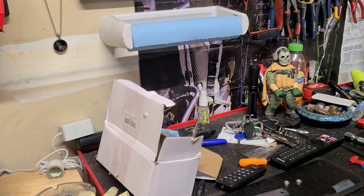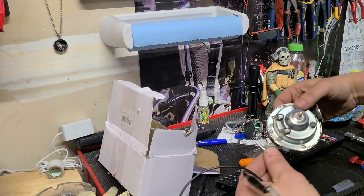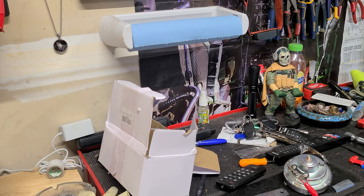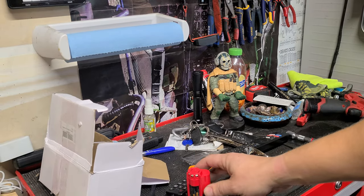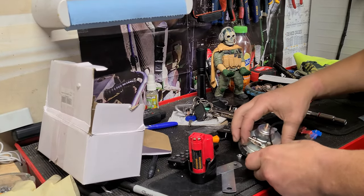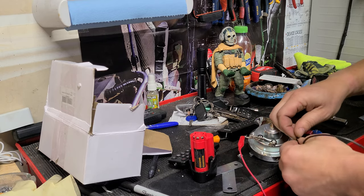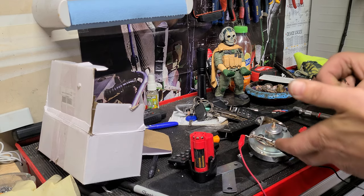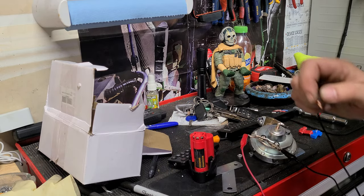Since we're doing a modification, this is going to be a little longer than your average horn replacement video, because we're going back in with four horns. Let's test everything using a 12-volt battery source. Positive, negative — this will be the third horn we're testing. We just want to make sure they all work before installation. That one's working.